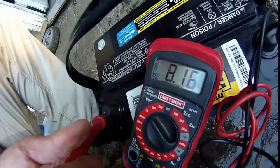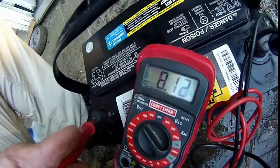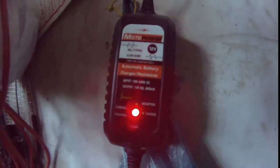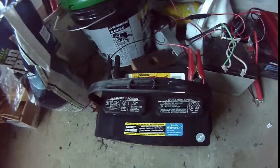I'm seeing 8.16 volts. So we're going to charge it and see what happens. I put it on this Motopower 12-volt automatic battery charger maintainer — input is 100 to 240 AC volts, output is 12 volts DC. Right now it's charging solid, so hopefully I'll get a solid green tomorrow and then it will be all good.